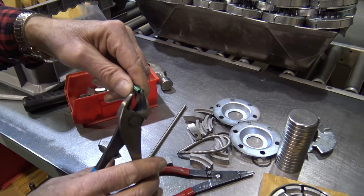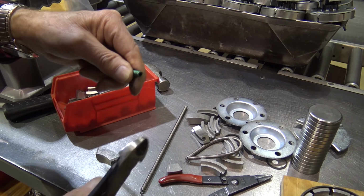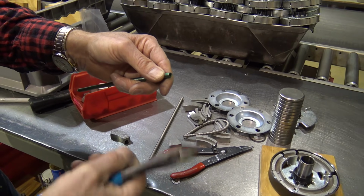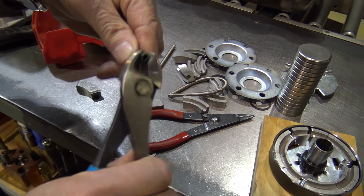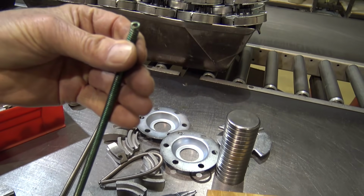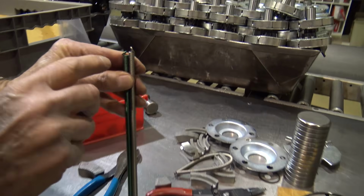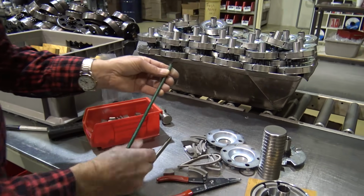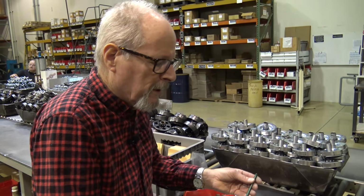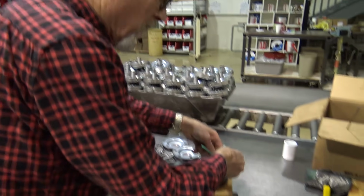going back to the side I just did, I'm going to cut out 2 loops. The loop that I bent out and where I just cut it. Again, now I'm just going to bend this one. There's the bend in it. It's completely closed loop. It's now shorter than this one, so I know the engagement is going to go up. But the nice thing about it is, because I didn't cut more than 3 loops off this spring, I can get it back together again without cursing too much.